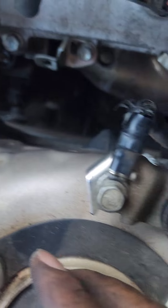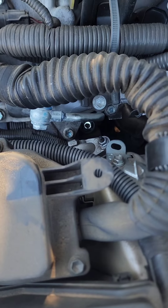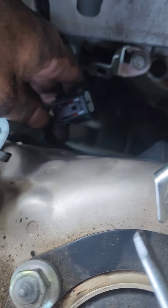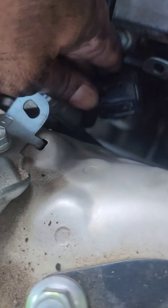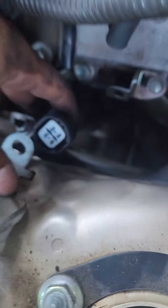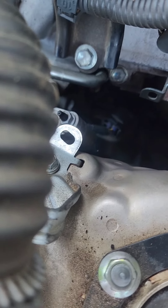Now here's the electrical connector on the alternator. I'm going to go ahead and pull that back — press down and pull out — and then I should be able to loosen the front bolts and be good to go. It's a little dark and hard to reach in there. If you have big hands you're going to have a lot of trouble reaching in there.